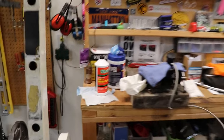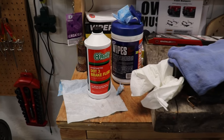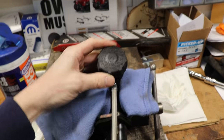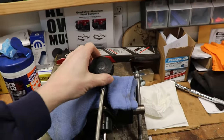We've got a nice fresh bottle of brake fluid DOT 3. You've got to use a new bottle or a fresh bottle — you don't want to be using old fluid for this. Some systems come pre-bled, but this one is not. This one is obviously dry.